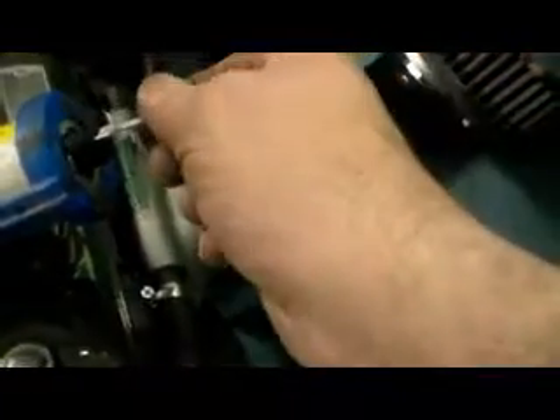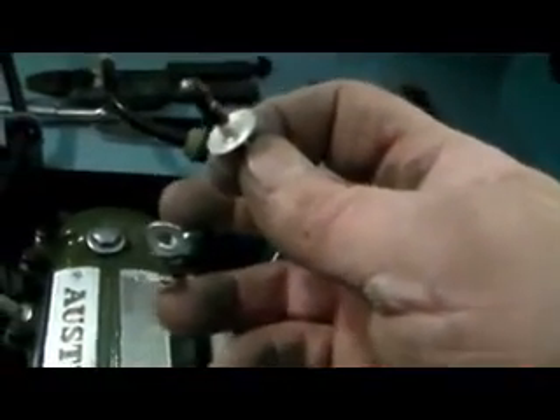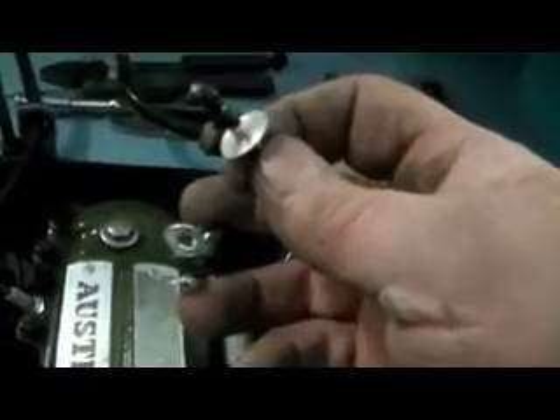Because I'm making holes all over the floor, I'm going to be putting a little bit of tiger seal on the rivet and on the base of the P-clip - to act as a bit of a gasket - otherwise Mary's feet will be getting wet.